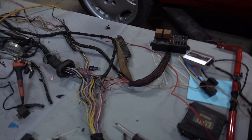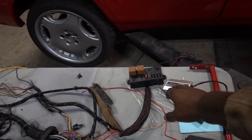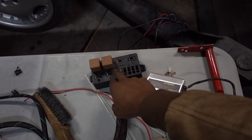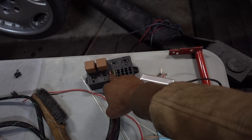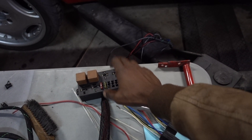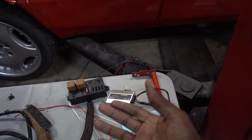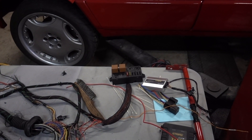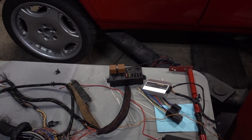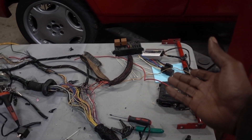Here's where I'm doing the wiring. There were also a bunch of relays that were not used. There's still a 40-amp fuse that shouldn't even be in there — the max current on this should be 20 amps. Inside the relay box there were a bunch of burnt wires going to relays that had no function. One of them did have a function — it was connected to the MAP sensor, and I don't know why that was on a relay.